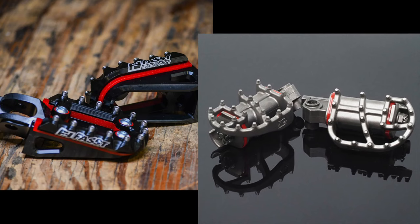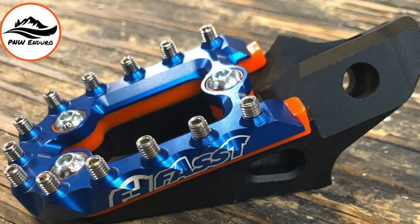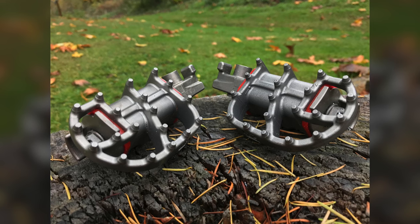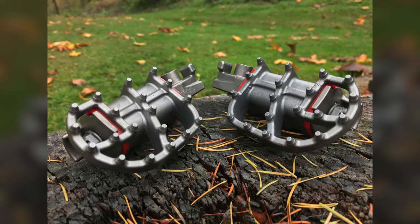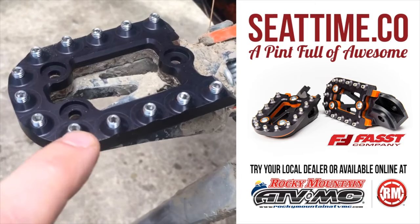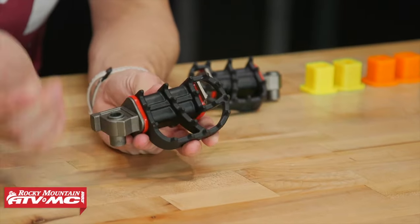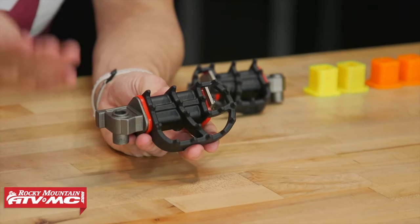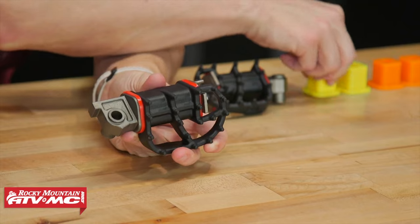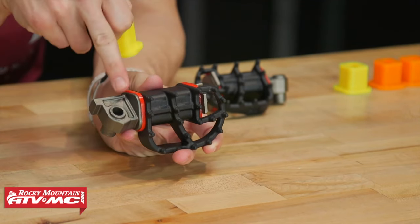To close out vibration dampening — both Fast Company and XC Gear make dirt bike pegs to make your ride less aggressive. Both companies came to a solution in two different ways. Fast Company has adjustable pins on a CNC plate that houses an elastomer, stopping any metal-on-metal contact. XC Gear sticks with their 360-degree approach, creating a steel peg that houses two elastomers for fore and side-to-side movement dampening.